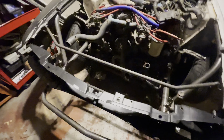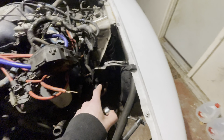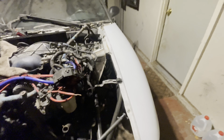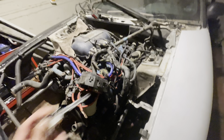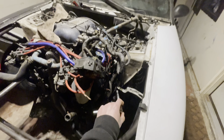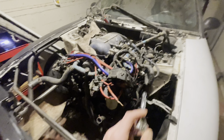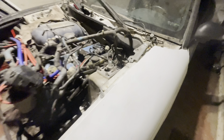As you can see, guys, this is all mocked up. I do have the fenders mocked up. This is not welded or anything — this is literally just clamped in place. I'm about to take this back apart because I need to weld-through prime the backside of the strut tower and also the backside of the tube front end before I weld it up. But I want to explain to you guys what you have to do to go about doing something like this.